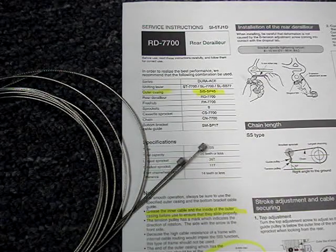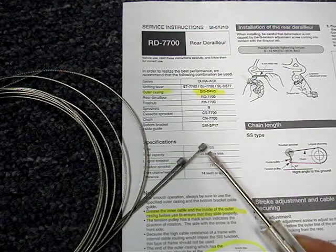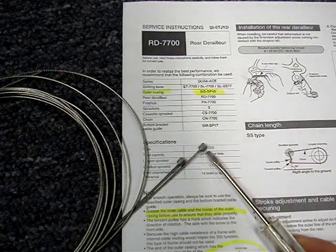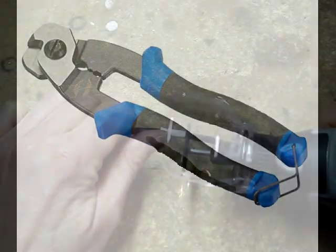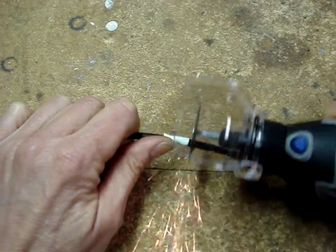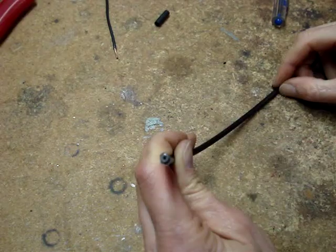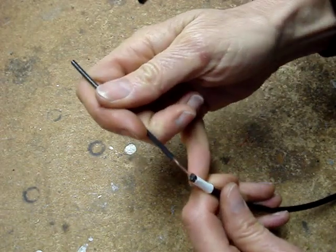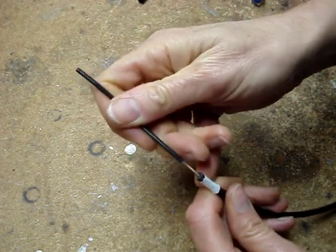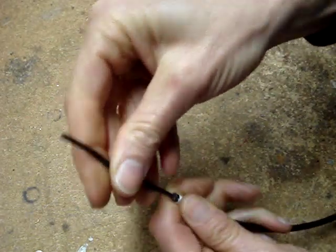I'll install stainless steel cables. The ends are compatible with Shimano or SRAM. If you have Campagnolo, those ends are often a little smaller than these. Measure the old housing and cut identical lengths. You'll need cutters designed to cut shifting housing, or you could use a Dremel and a cutting wheel. The end of the cable should be cut squarely — the end should be round, not ovalled. In the center of the cable there's a plastic liner; open that up using a piece of solid wire or something else that's pointy.